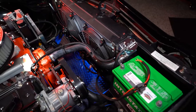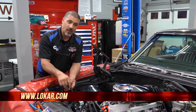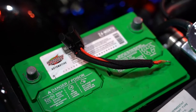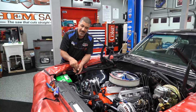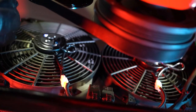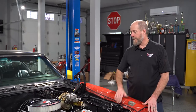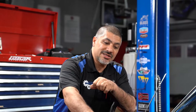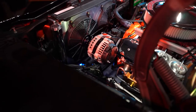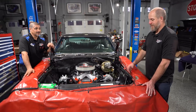We've got two fans from Champion and two relays because the Holley EFI has two ground-trigger outputs. On the relay, the switch is going to the power wire and the ground is controlled by the Holley — when it turns off, the Holley shuts off the fans. The power for the fans comes from the relay; the ground goes down to the core support. Sam, this came out really nice. I like that the factory shroud and clamp held the whole thing in — no brackets or modifications needed. The reason Champion Radiator fits so well is because they design these per the specification of the car and application in-house. If they don't have your application, they can custom-make them. And for as long as Skip owns this car, Champion Radiator is going to give him a lifetime warranty.